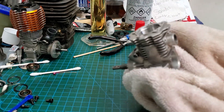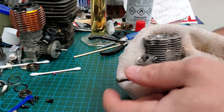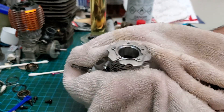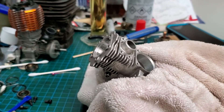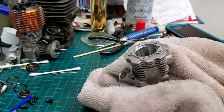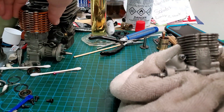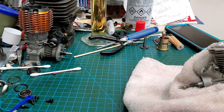There's an old trick where once the bearings are seated, you wrap the engine in a cotton cloth and let it cool down slowly. Some people do it, some don't — it's up to you. Also worth knowing: the Losi 3.4 takes the same size bearings as the 3.3 or 2.5, in case you didn't know.